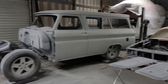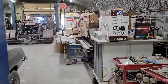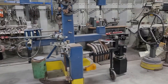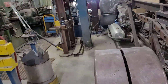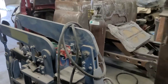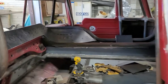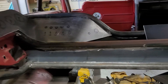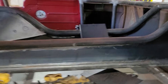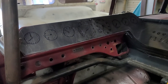We did some work on Bob's COE up here, so let's take a little wander through the shop. We've been working on the console on Bob's truck. The idea behind that console was to incorporate the roll cage in with the console, so the tubes will remain painted the same color as the roll bar, and then the center insides will be the same colors as the dash and the exterior of the vehicle. We got all that welded in solid, and the dash face is fitted.